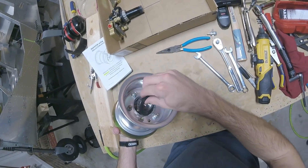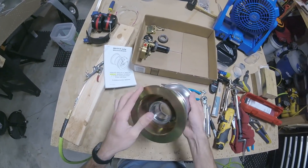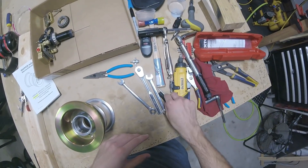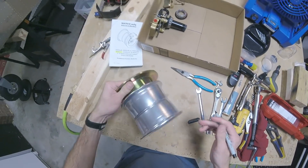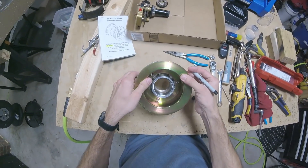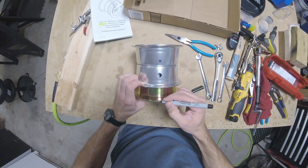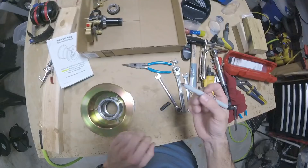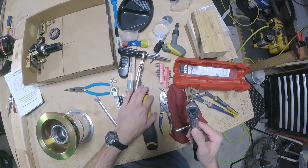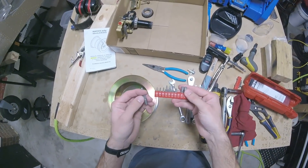We've got the bearing on this side. Now we've got our wheel, the two wheel halves, and the brake disc right here. At this point it's a good idea to mark everything. There are marks right here already, so we'll just line everything up with those marks for reference — make a little mark so you remember how to put it back together. Now we're going to use a T27 Torx bit.